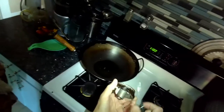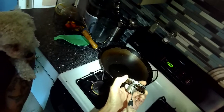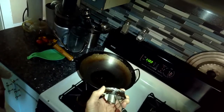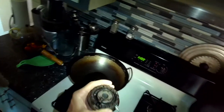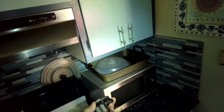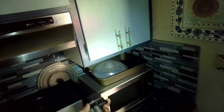Once you do that cleaning of the jet, you might also want to look at the burner. Some of these just pop right off, some are held in by screws. Look for a little hole here — you want to make sure that hole is clear too. You can use something pointy to poke through there, because that's where gas is supposed to come through and mix with the spark to light. Sometimes that hole gets clogged and the gas can never reach the area where the spark is.